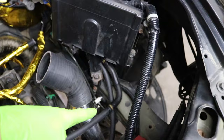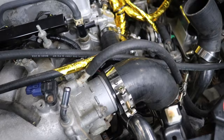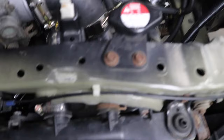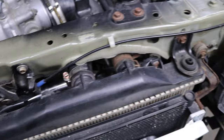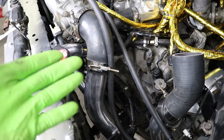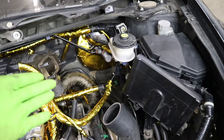Our purge line is run to here — we still need to put our purge valve in line and decide where I'm going to be installing the purge valve, because we need to put this somewhere in line and have this wiring connector reach it. Wherever we relocate it, it's just a two-wire connector — we just got to extend two wires, which is not a big deal. Outside of that, we got both rad hoses fully installed with hose clamps on them all including the lower rad hose, which is going to be very hard to see down underneath the intake manifold. They are aluminum hoses that come in the kit with four silicone couplers with hose clamps. We got the whole cooling system sealed up at this point, other than to the turbo. The last thing we got to do before we get this turbo 100% installed is run our fuel line.